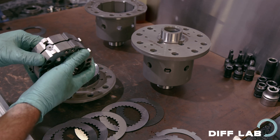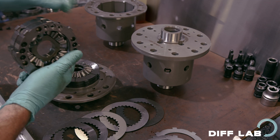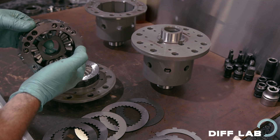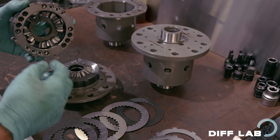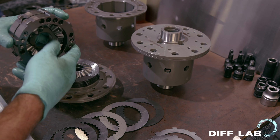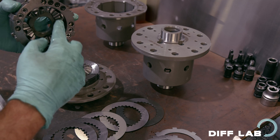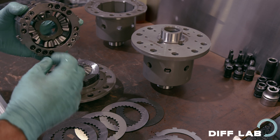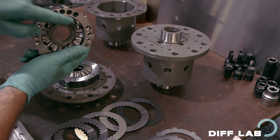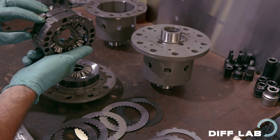It comes out as one piece, and you can see this is the way it runs. The car applies drive via these little dog ears — it turns like this. The wheels are connected to these gears, meaning as this turns these gears are driving the wheels. Imagine it being hard to turn the wheels because the car has mass — it requires some effort to get moving. These cross bars here are really the clue to how the limited slip action works.